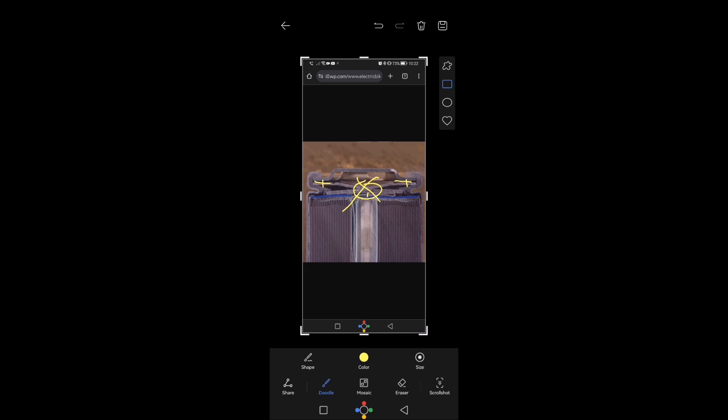If, when we press this down to make it flat again, we puncture it or maybe it cracks in the weak spots — you can see it has two weak spots — if it cracks in any of those or we rupture it while pressing it down, air and pressure will not build behind it; air will just escape. So this will never be disconnected again. We have a permanent contact and this can overheat, create even more pressure, enter a thermal runaway and make bad things. Hopefully you understood — this should not be done except in an absolute extreme situation.